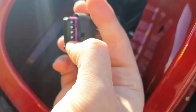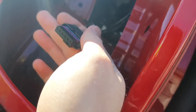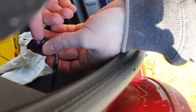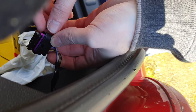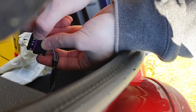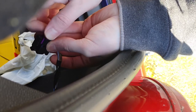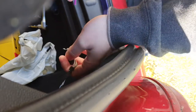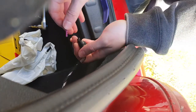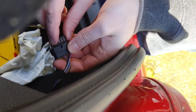First you have to take this little purple clip off so you can remove the pins. So I'll give that a bash and see how I get on. I've propped my phone up on the parcel shelf so I can show you how to take this out. You want to get your nail underneath this little purple clip and you literally just pull it — it should just slide out sort of like jagged, like a sawtooth. Once you've got it out, that's what it looks like. A little tip: I've got it through that little hole in the side just so that if anything falls it falls into the boot and not down into all the gunk that's under the lights.